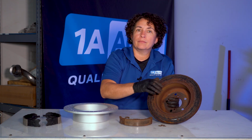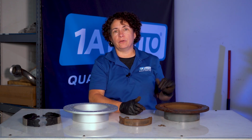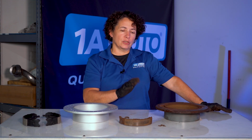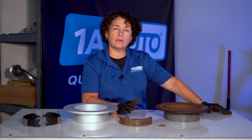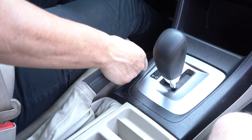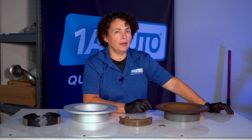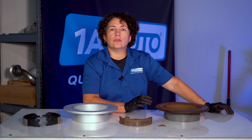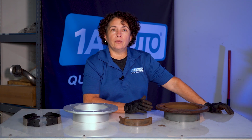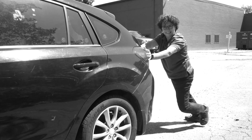And that happened because, well, for one, I'm sure they never used their parking brake. They have an automatic transmission, and they think, oh, we don't need to use that. Just people with manuals. Well, it's actually wrong. All cars come with parking brakes. Some come with electric. Some come with manual, which is when you pull up on that lever or push down on that lever. If you don't use that parking brake at all times, even though you have an automatic, not on a hill, eventually it's not going to work when you need it. So either you use it or you're just going to lose it. It will freeze up on you. Wheels won't turn. That one time you park on a hill every 3 years, well, it's not going to work.